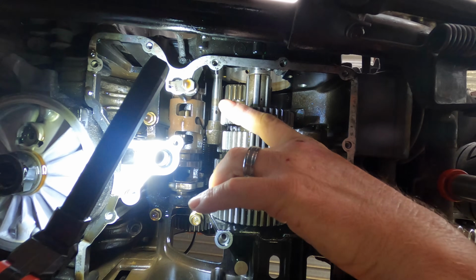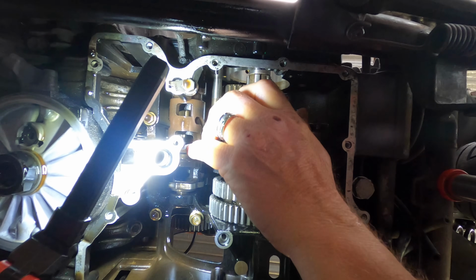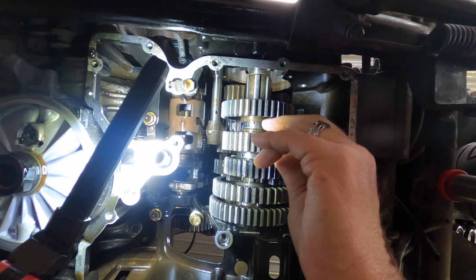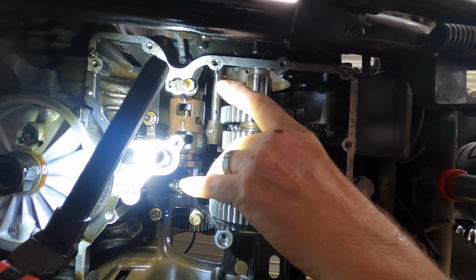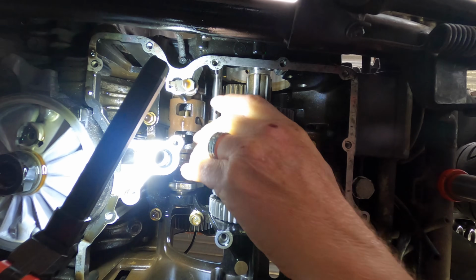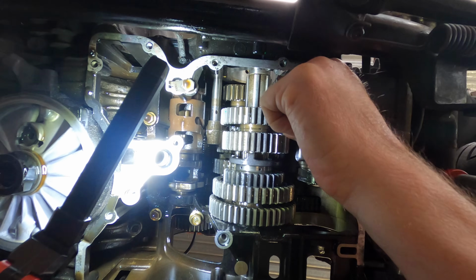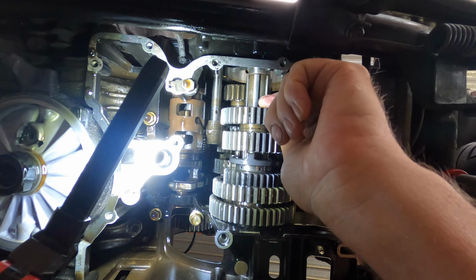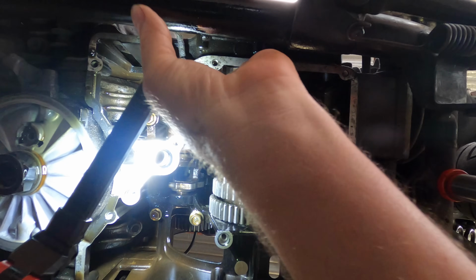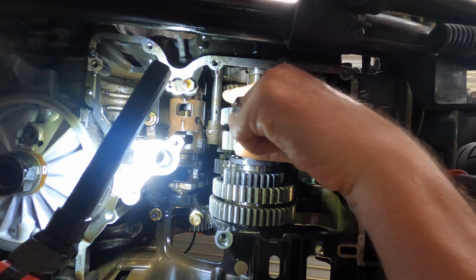Then I was able to kick that gear and jam it up in here where it belongs. Lifted all that up, the shaft went in, and then I grabbed hold of this engagement gear, pulled it back, and that pushed the circlip back into its groove. So that's all assembled there now. But the problem that we have is I can't do the washer swap, because for whatever reason the tolerance stack has allowed it to get to the point where the clearances aren't there to have this shaft at an angle and trying to engage it and clear that gear at the top.